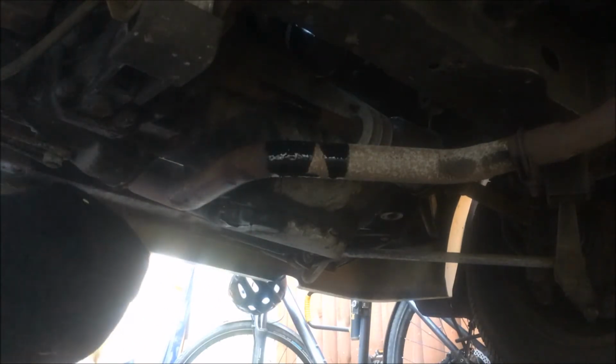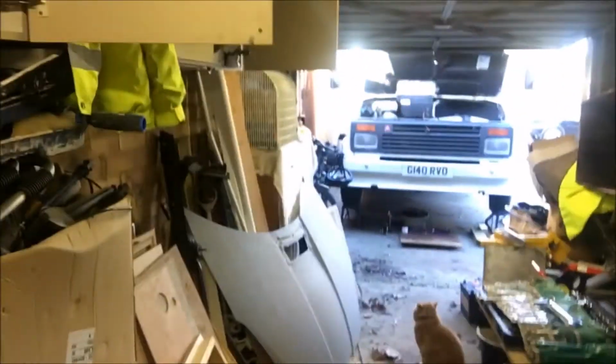Right. Okay, well, unfortunately, I couldn't use the new sump plug because it just wasn't right. Some of the thread wasn't very cleanly cut on it, and it didn't go in to the sump very convincingly, although it was definitely the right thread. It was a cheap eBay part, so I guess there's a lesson there maybe. Anyhow, I used the new copper crush washer on the old sump plug and just tightened it carefully, so hopefully next time we come to do this we will be able to get it off again. Even Mr. Ginge did agree that that was the best thing to do.